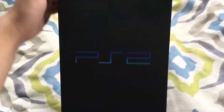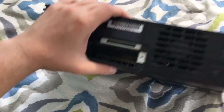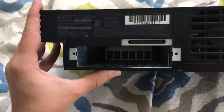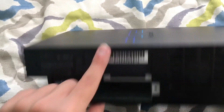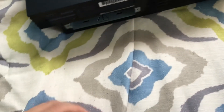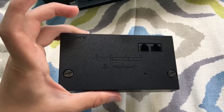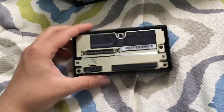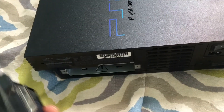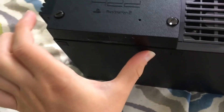First off, if you're using an original PlayStation 2 fat model — I call it a model one — on the back you'll have an expansion bay door, usually with a piece of plastic covering it. You can take that off and you'll have a slot for the network adapter. This is the official Sony one, which gives you both ethernet and phone line connection, allowing you to play online or over a local area network. Inside it you can even house a hard drive, which is why the PlayStation 2 has all that hollow space inside. To install it, just connect it in place and use a nickel or something to screw it in.